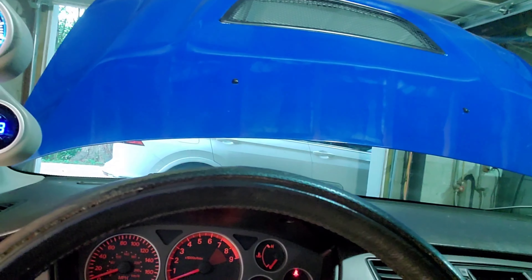Since this is an SSL build I've got HIDs with adjustable high beams — just unplug that, you can leave the rest hanging. What you're trying to get to is right here — it's just held on with a phillips head screw. Mine is a bit loose from the issues I've been having. Take the screw out, unplug the connector — it has a little clip it rides on — slide it off.